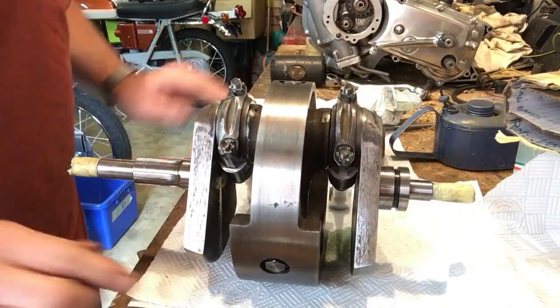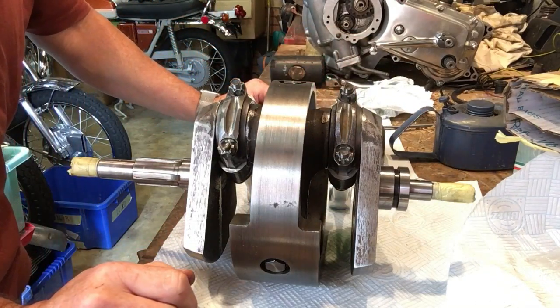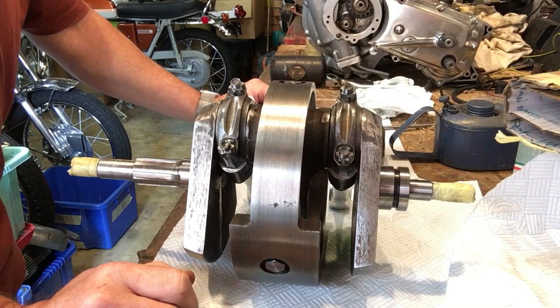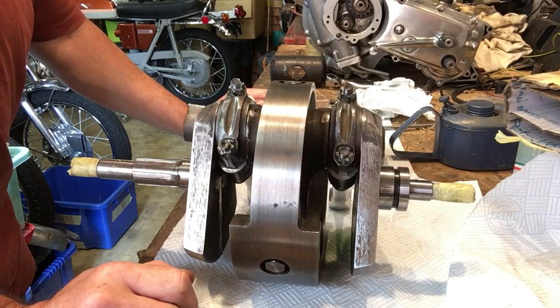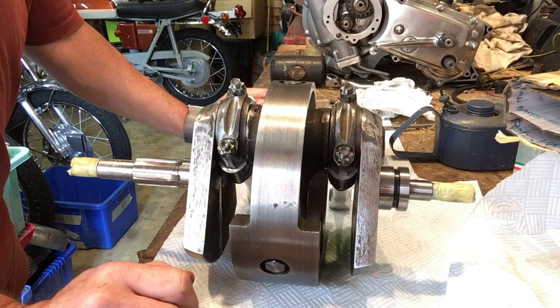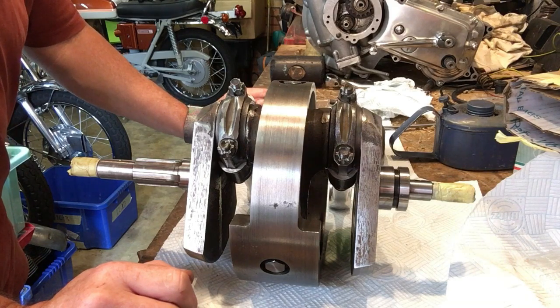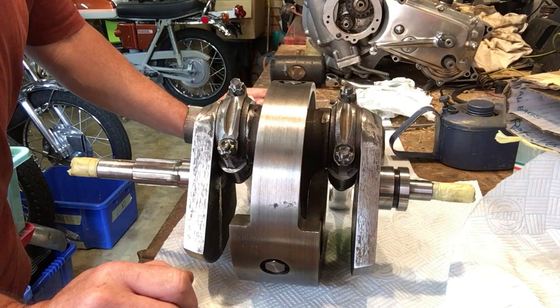That all feels nice. That's the first job done then in the build-up of the A70 Lightning motor. Normally what I do before I put the crank into the crank cases is to fit the pistons. I'm not going to do that today though because we do have a honing job to do on the A70 barrel - to check the piston fitment and the ring fitment in the A70 barrels. So we won't fit the pistons just yet. We're still awaiting receipt hopefully today of the bore gauge which we'll also need. So we'll leave this where we are. That's the first job done - we're on our way beginning to build up the A70 again. In the next video we'll focus on the barrels and the pistons.